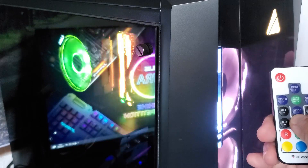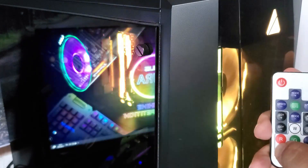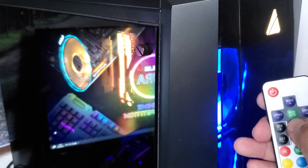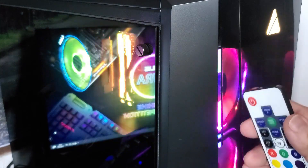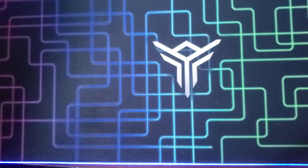Many of them are outdated. I bought this AZA case with RGB fans and asked the store if it was compatible with an Asus Gaming TUF to configure Aura Sync. But the surprise I got when they delivered it to me is that these cases come with fans with RGB connectors 5V 3-pin, and the Asus TUF X570 I have has a 4-pin 12V connector, so it is not Aura Sync compatible and a Chinese RGB remote control must be used to change colors.